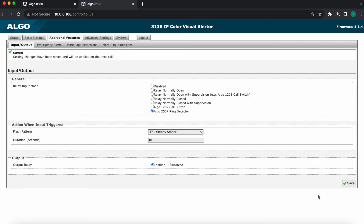Very simple physical setup as well. That's pretty much it. The last aspect to this would be configuring the phone itself. In order for the phone to be compatible with the 2507, it must be able to provide ring audio through the headset port. Phones that have that capability are generally going to be compatible. For any questions on compatibility of phones, obviously contact our support team. But if it is a compatible phone, such as this one that I have here, you'd go onto the web interface on this phone.